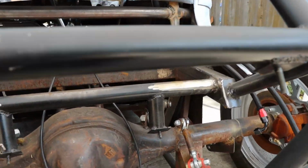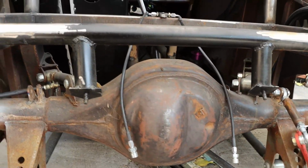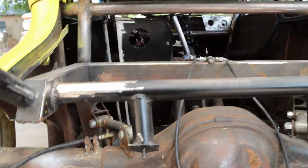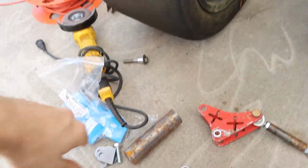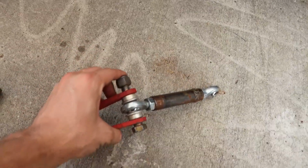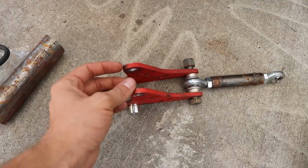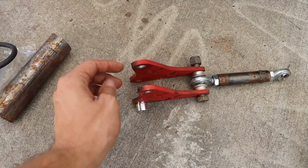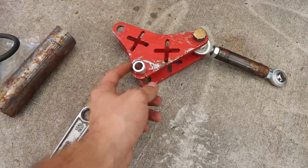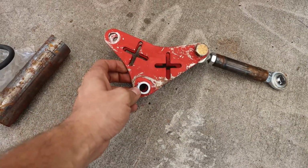So now the mission is to redo the coilovers so that obviously I can make the car a roller again. But I'm going to take a little more time on the coilover setup, and this is because the mission now is no longer using a bolt as a pivot point, which isn't bad to say, but basically what happens is there's a lot of tension and, I guess, a little bit of bind. So this would be the pivot point here. Obviously you can see where it was pivoting around the bracket.